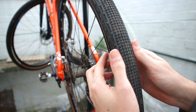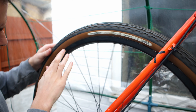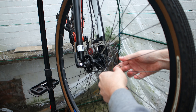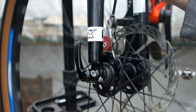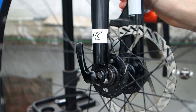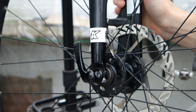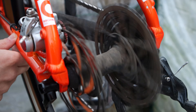As well as the tyres, I also want to look along the rim. The best way to do this is by feel — run your finger around the rim and just make sure there is no damage. You also want to be checking the spokes, making sure that all the spokes have the same tension. I do this by having a hand each side of the wheel and simply pressing them a little bit. I also like to check how the bike is performing before I make any changes so I have something to compare to — simply spinning the wheels and seeing how they roll. I'm also going to check for play in the bearings by moving the wheels side to side, looking for any sideways movement.